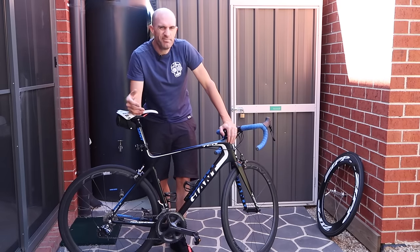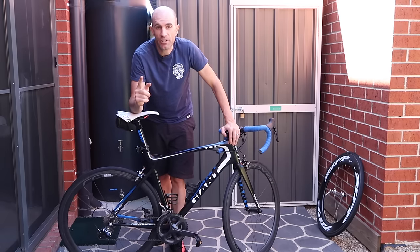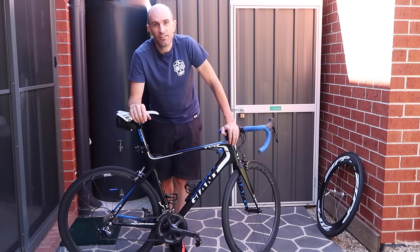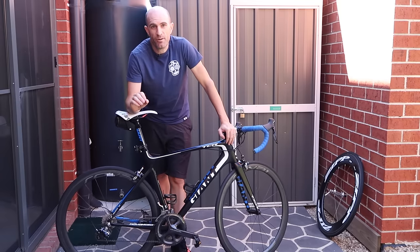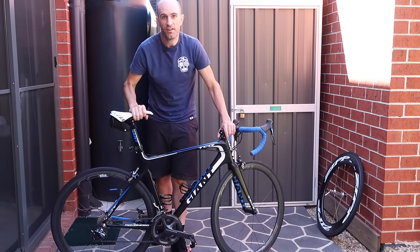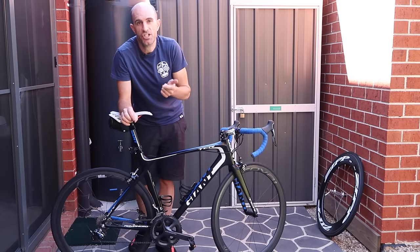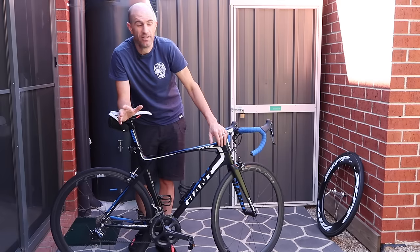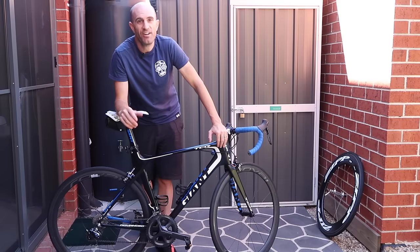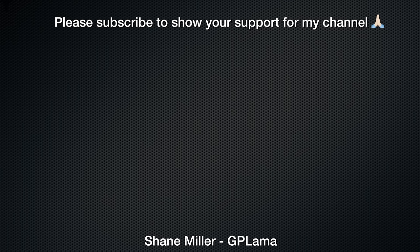So would you do this to your commuter bike? Probably not. On the indoor trainer, maybe if you've got a rear wheel trainer. Would you do it if you're going for an hour record in a smooth velodrome? Absolutely. For outside time trials and things like the Indian Pacific, you don't want to be travelling across Australia with a bike that's slowly shaking. I'd recommend for all those riders to have a look at your wheels before you take off and make sure everything is optimized — 5,000 kilometres of buttery smooth is far preferable to 5,000 with that little shake in your backside the whole time. Thanks to Harry Frick and Stuart Vaughan for originally sorting out wheel balancing, and to Raoul Lucia for adding his two cents on the topic. Definitely worth doing. Thanks for watching and we'll see you soon riding smooth.